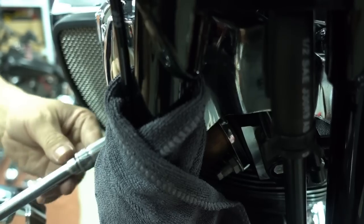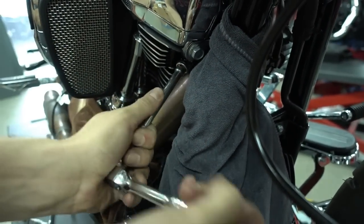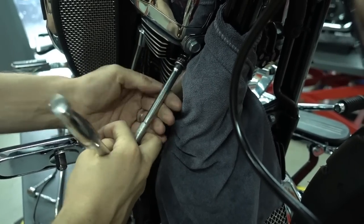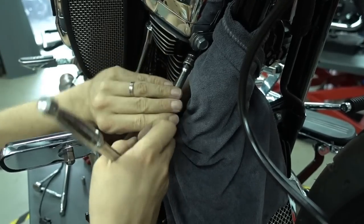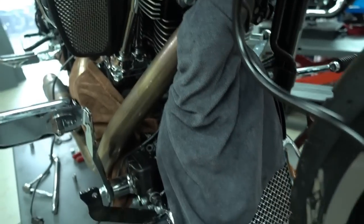So there's still the two remaining nuts here on the front cylinder. On the upper one, you can use a normal socket wrench like this one here. On the lower one, you can't. There's not enough space, and you would just hit the frame with your tool. So you have to use a normal wrench there. First thing is, take off the first nut, keep the nut.